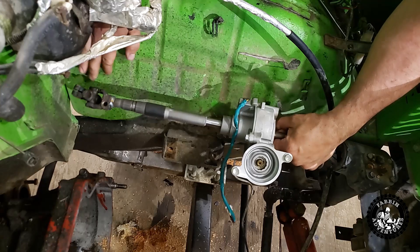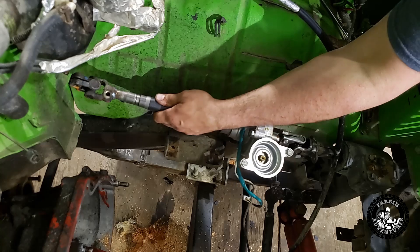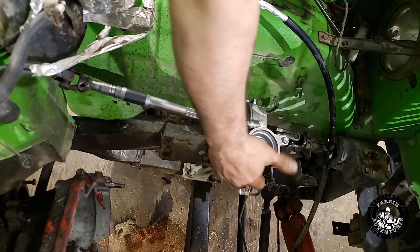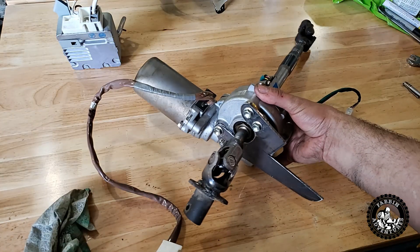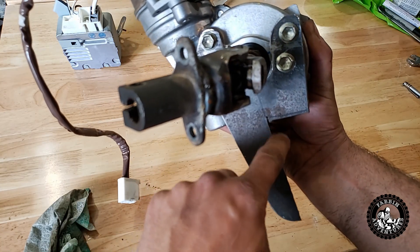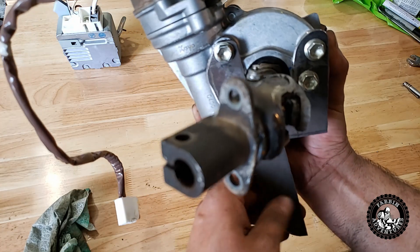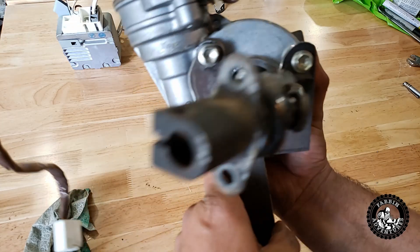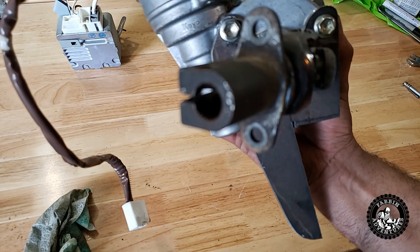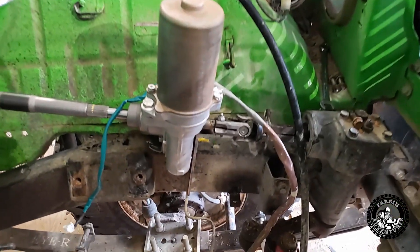If I've got this figured right, we should be able to slide this up where it's got to go — up in here — there we go, and there she's in. Here's the bracket I made for the frame: this sits on top of the frame, this goes down the side of the frame, all three bolts in there. The only torque on this thing is twisting — there's no forward-to-back torque — so I'll just weld it across the frame and down the frame and we should be good.